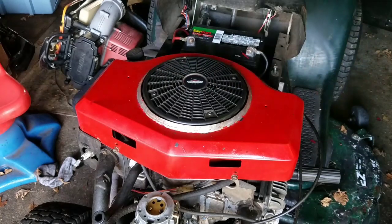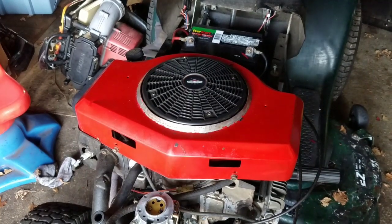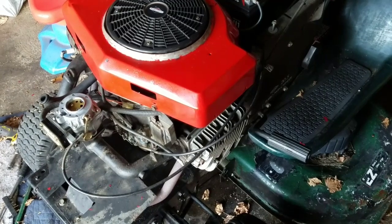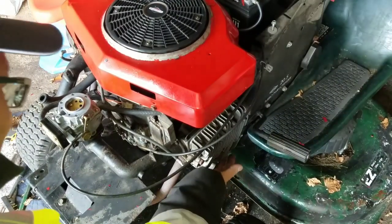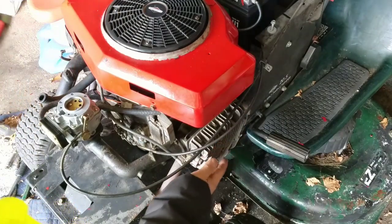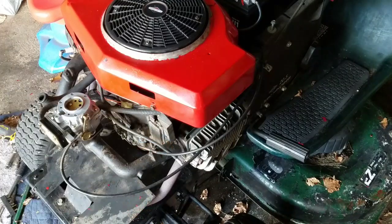Anyway, so I've got this all done. I need this side tin, the black metal tin that isolates the air off cylinder number one's head. I need that. You need that. Otherwise, this will overheat prematurely. I don't have that, and it's like $20 on eBay, which I'm not going to pay, but I think I might have some Kohler parts.